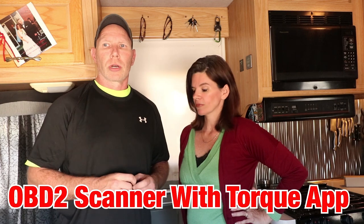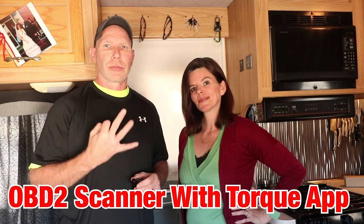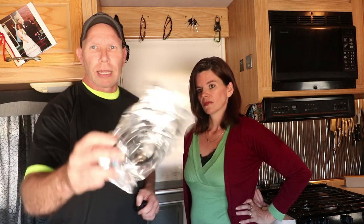All right, guys. Well, we got a couple things we got to do today. The engine light came on in the RV, so I put the code reader on it and found out we had three codes. Two of them were O2 sensor codes, bank two, sensor two. So I got that delivered, and the third code was for the TPS, the throttle positioning sensor, and I got a new one to put in today.